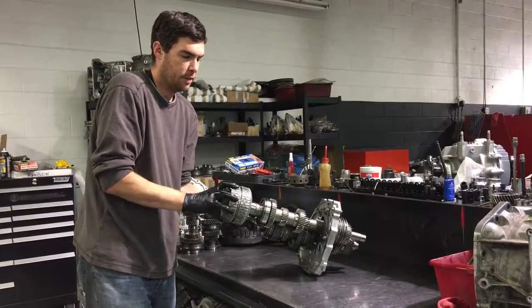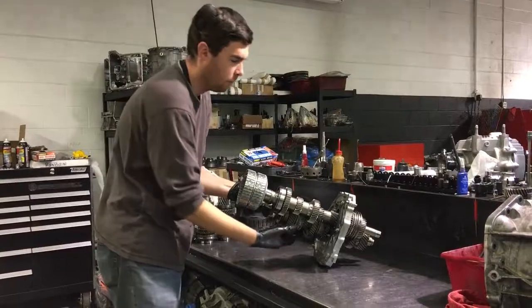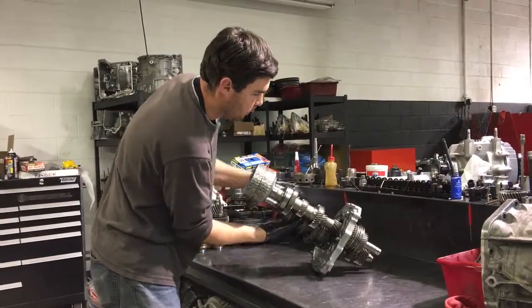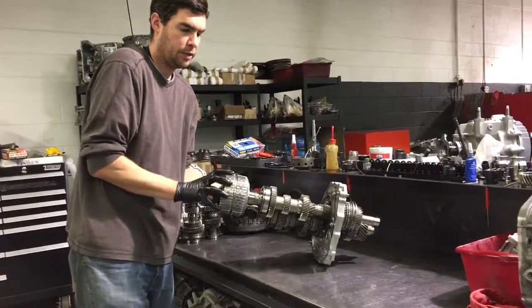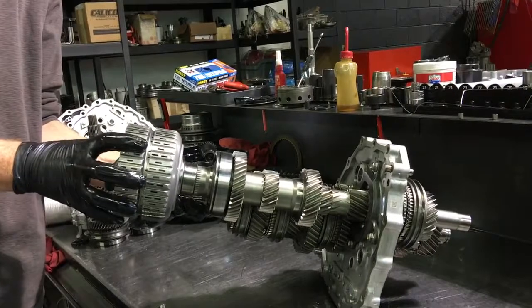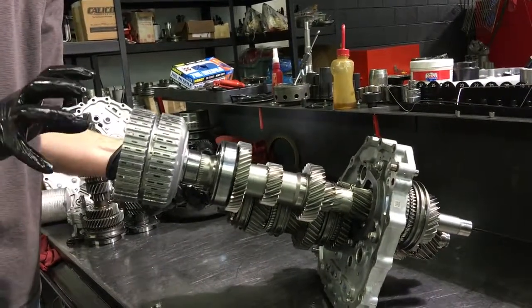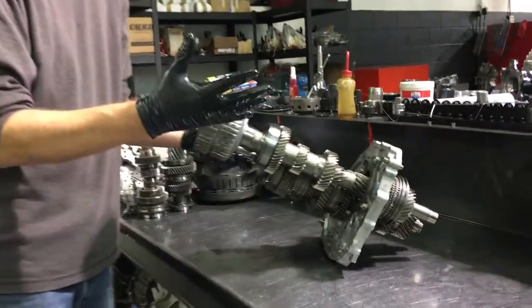As you can see, since it's still engaged in second, the A basket is still rotating at a greater speed until it pulls out of second and goes into fourth, and now that's rotating at a slower speed. When you're about ready to transfer the power to fourth gear, the clutches will let go of this basket, engage this basket, and then you're in fourth — and so on.